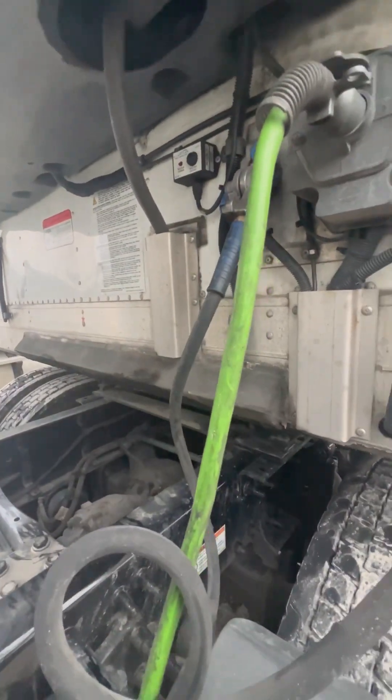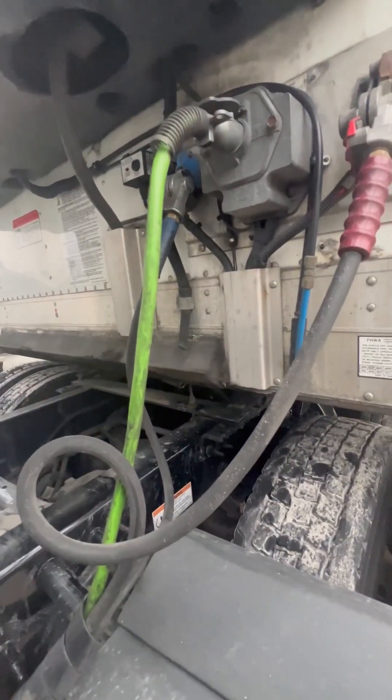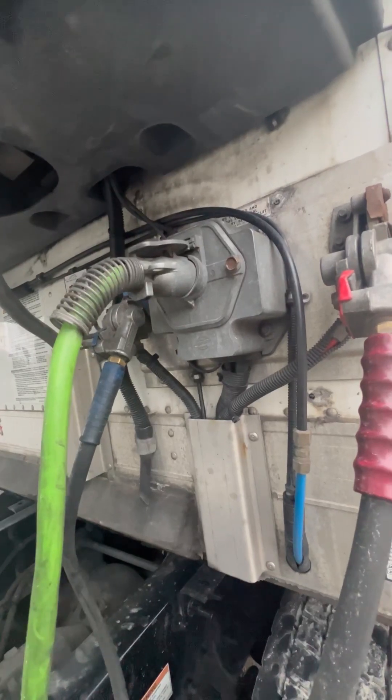That's the tractor. I would go to my trailer. I got my emergency line, my electrical line, and my service line with the glad hand and glad hand seals — from the back of the truck to the front of the trailer, all properly mounted, secured, not cracked, bent, or broken. The hoses are not cut, torn, frayed, or leaking.